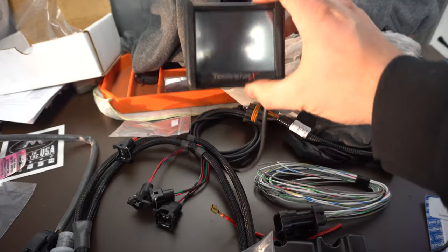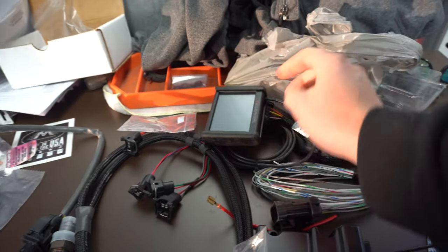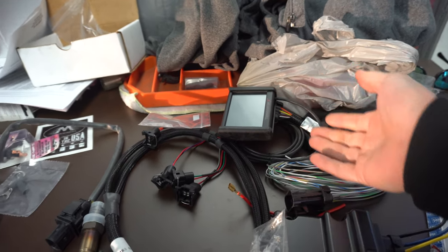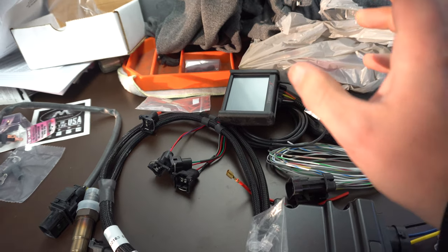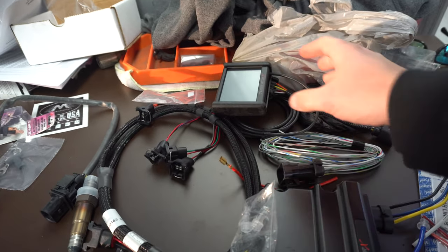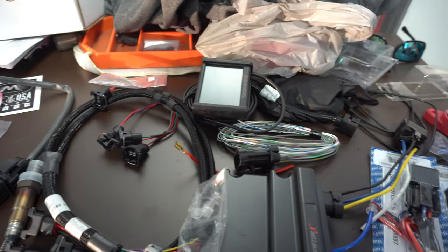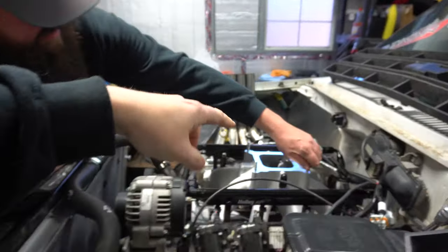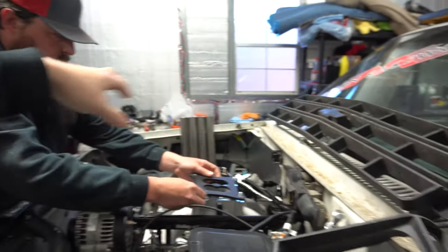The piece that will need to be mounted in the truck is a little three-and-a-half-inch display that you can tune off of. I'll probably end up ordering the little adapter cable that converts it over to be able to use the whole computer and program for tuning. I'll probably try to do the initial fire-up to show you guys how you can do it as well. Alex came by — he's going to help me get the throttle body on. We're going to try to get some stuff sealed up, start plugging in wires, move our way into the truck, and just wire the truck as I go.